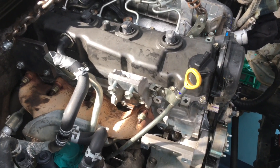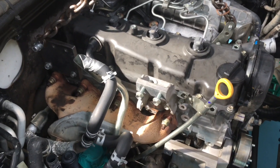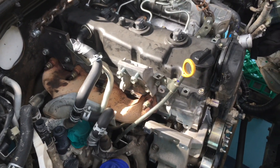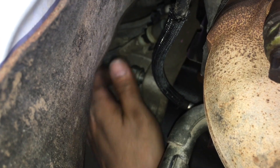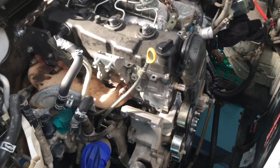The engine is sitting on the mounts, the bell housing is in, bolts are going into the bell housing. Do you check that the torque converter's spinning freely before you bolt it up? Yeah — line it up, put the bolts in. There you go — he's got the bolt in the hole. And mate, this thing is in. Bolt everything back up and she'll be running by the end of the day.